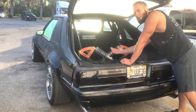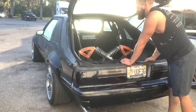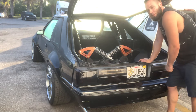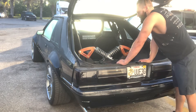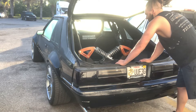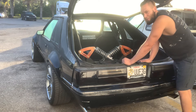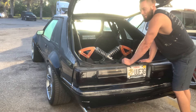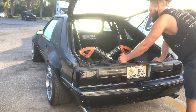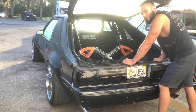I got custom spacers to keep everything aligned and from touching. It's very convenient — I can adjust it from up here. I don't have to get under the car to change or adjust the coilovers. I've got double-adjustable right here in the hatch — I could probably reach back from the driver's seat. To change the springs, just jack it up a little, relieve the tension, unbolt it, pull the spring off — probably a five to ten minute job. Overall, a lot of people think there's a ton of interior noise, but I've got a 600 horsepower supercharged LS — it's not a Cadillac.